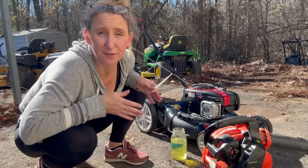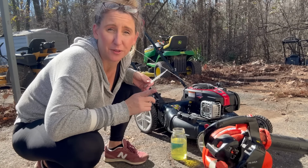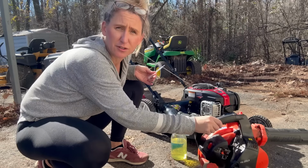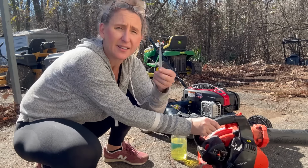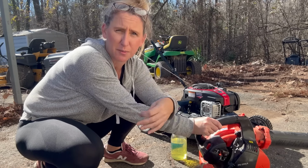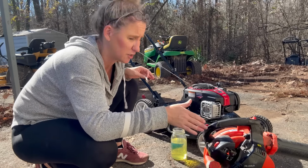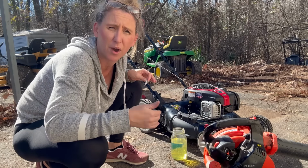Out of thousands of units, 70% of my customers could have stayed away from the shop if they knew this information. Now, if you've got a 2-stroke and you think there's water in it, like I said, guys, get some kind of fuel extraction device. I keep them all in the description box below if you want to get your own. If it's in your 2-stroke, just go ahead and pour it out. Get you some fresh fuel in there. Make sure to prime all that water out of your tank.